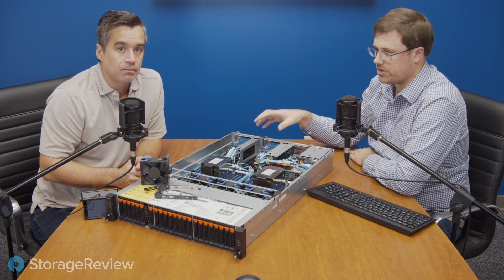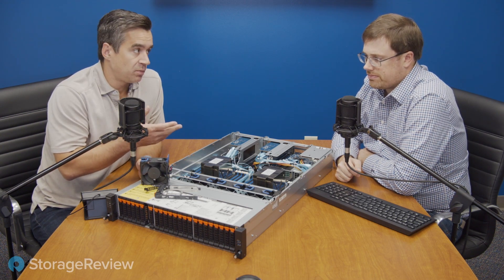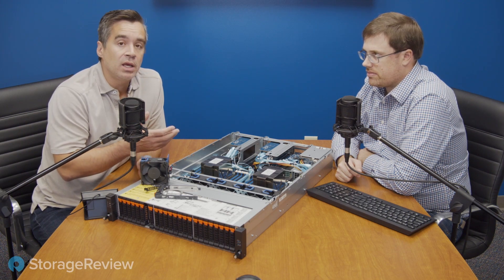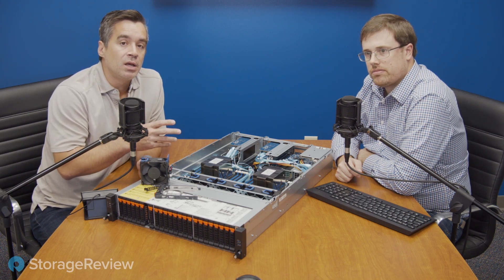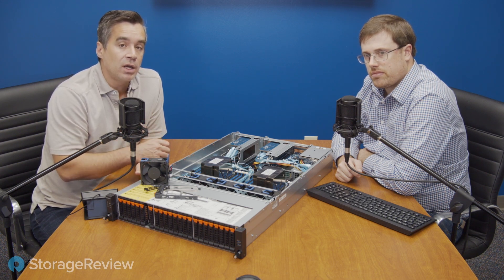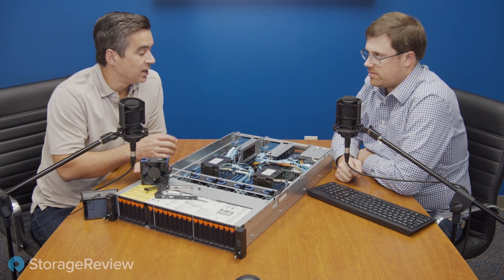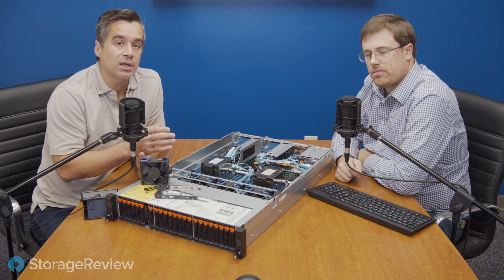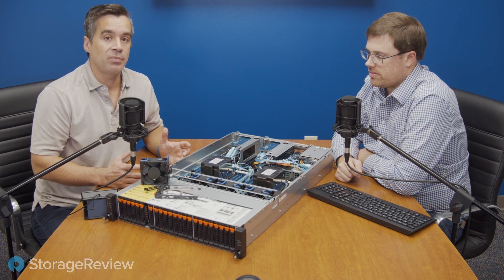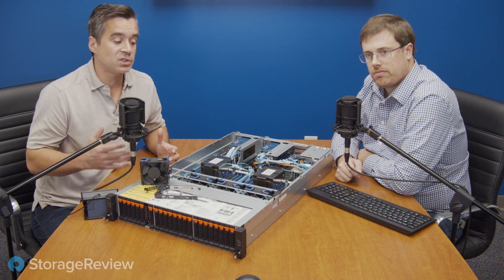You're still left with an OCP card slot and two open edge card slots, so there is room for expansion. The OCP slot supports up to 25 GbE networking, but you're really only left with two slots for additional I/O — an NVIDIA T4, a small FPGA, or similar. Just know going in that the expansion slots are a trade-off to get the 24 NVMe bays in the front.